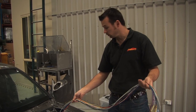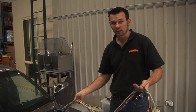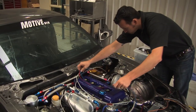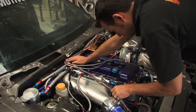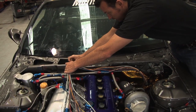With all the wires coming through the firewall into the engine bay, I'm going to route these wires and lay things out so that I can then cut them to length and terminate correctly. It's important to route your wires away from turbochargers and exhaust manifolds so that the wiring doesn't end up melting.